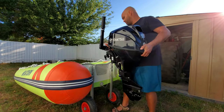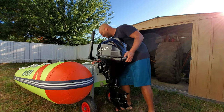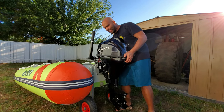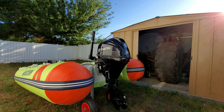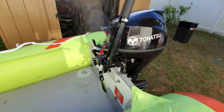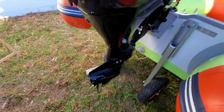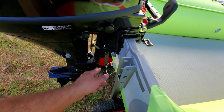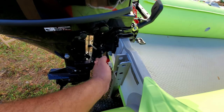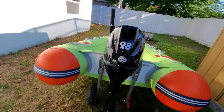I just finished the first 10-minute break-in run. I'm gonna put it on the inflatable to see how it looks. I ran it for 10 minutes in the water — that's the first break-in done. Oh, my new toy — it looks awesome! That thing is so pretty. It's on the number two slot, the way it should be for an inflatable, because the transom slopes inward and putting it on number two makes it parallel with the water. I love it.